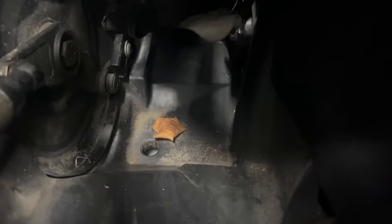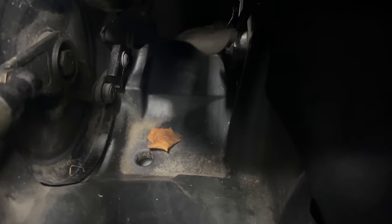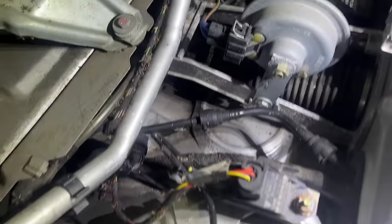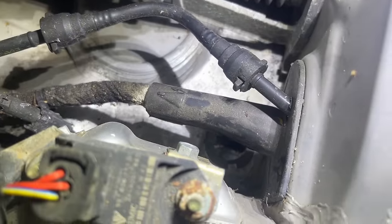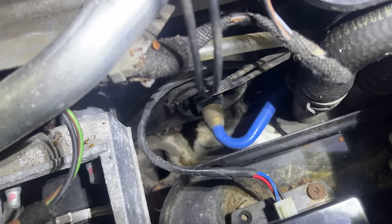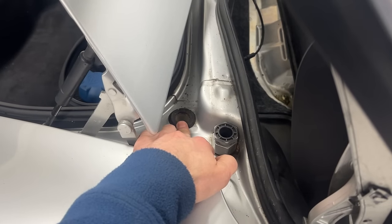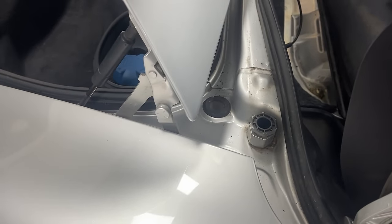There's one of the drain holes buried right underneath the roof. I'm going to insert my trombone cleaner and pull it out. That's the drain hole I cleaned last week and the one I missed is just down here — and it's the same on the other side. There's a drain hole either side just underneath the boot. It's got a little cover on it, so just need to check that it isn't blocked up.